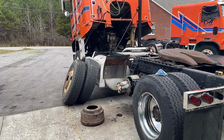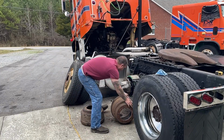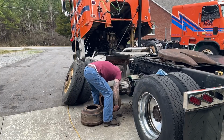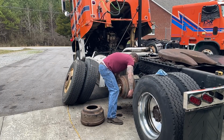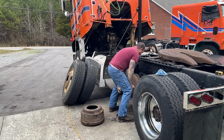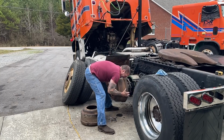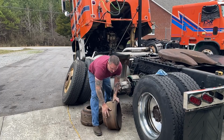this drum will work fine over there, and it's the 3141, and that's the drum that I looked up last night, just figuring how much deeper it needed to be to cover the brakes. And I know it's gonna work, but yep, brakes are inside 1/8 inch like they're supposed to be. So they just got the wrong drum.